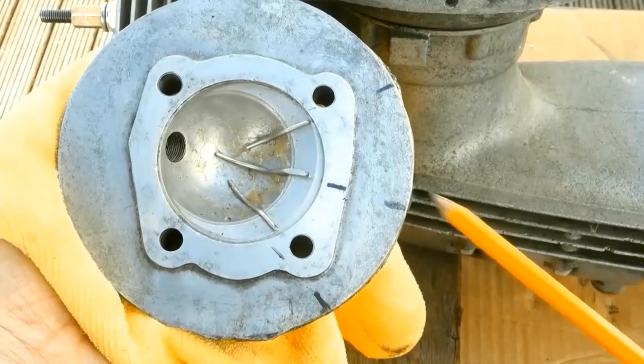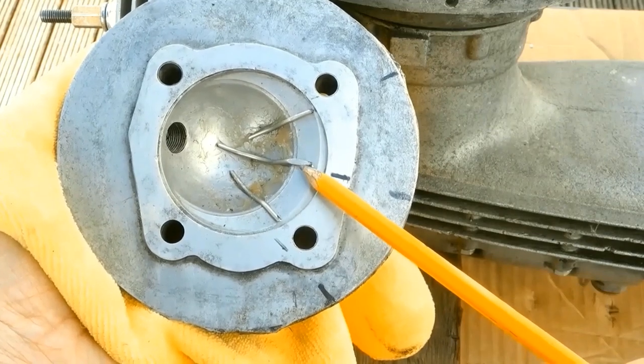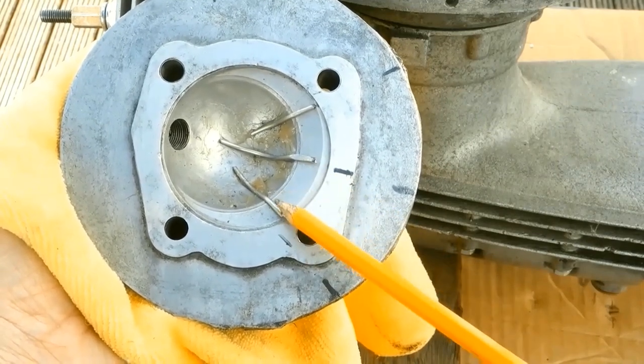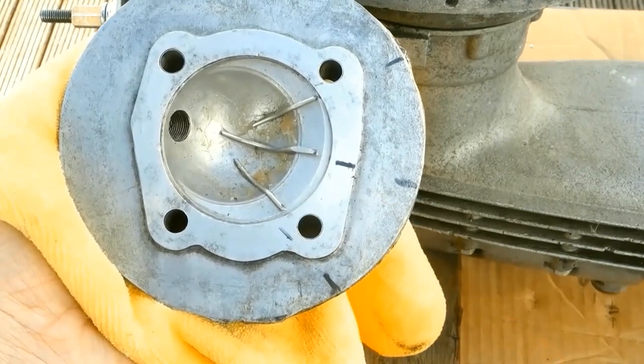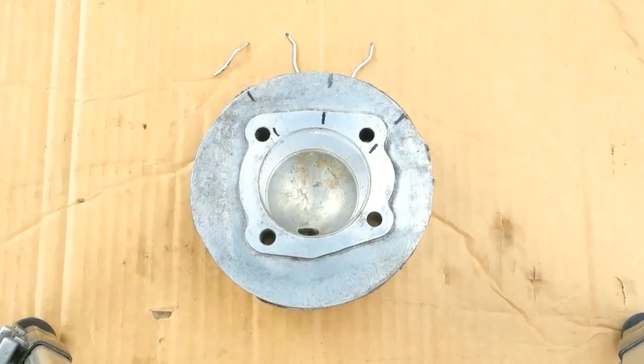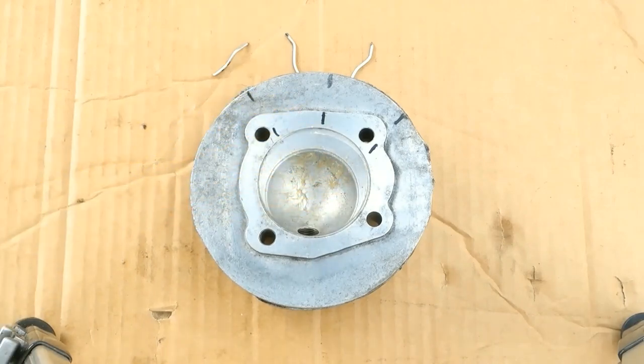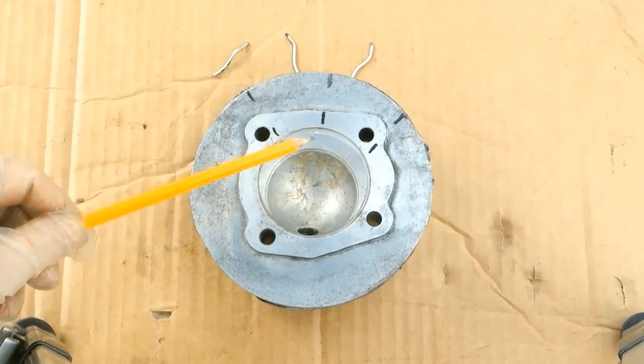Squish measurements. 1.56. 1.1. 1.25. 1.84. Taking this squish, probably covered this before, can't remember everything. It's recommended to take it in three places. I believe this is a squish ledge here, not a big area, but I presume three places still holds good for it.